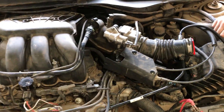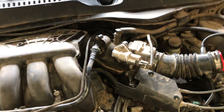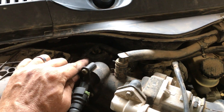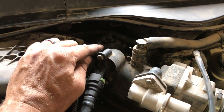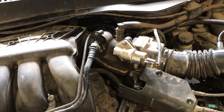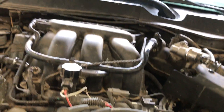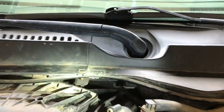Now you sit and wait for the smoke. We've already determined where it's leaking and I just want to give you a quick rundown of it. See the smoke coming out right there? Also, we put a rag in the exhaust to plug the exhaust fumes. We may have run it out of oil — there should be a little bit left in it. See the smoke? So there's our vacuum leak right there on this car.